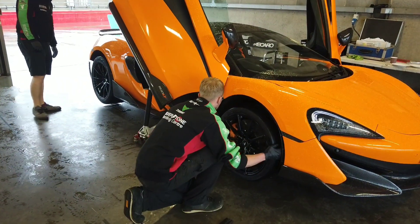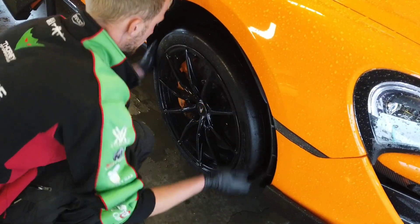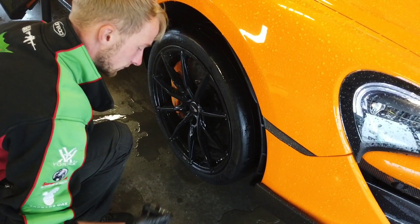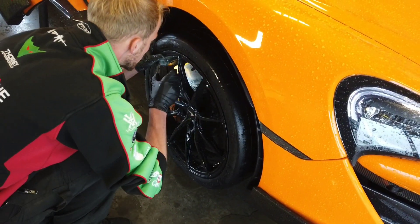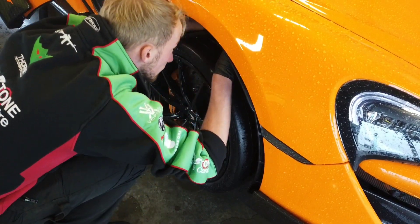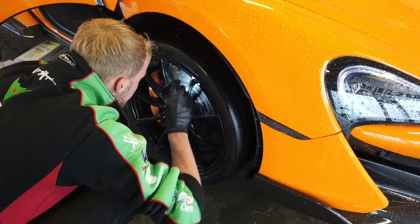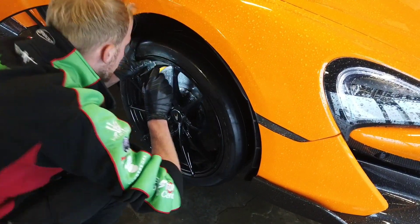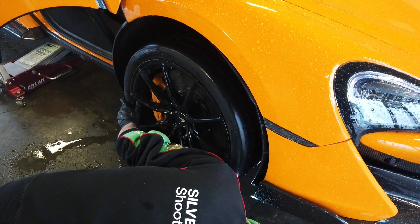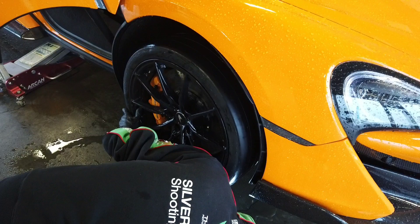What we're doing now is checking around both the front and rear wheels — mainly looking for play in the hub, making sure the wheel is all tight. Getting inside there, what we're looking for is evidence of suspension leaks. It's quite common that some of these cars have suspension leaks from the lifting system. Just making sure there's no leaks, no issues, no braid line issues. Also checking the wheel arch liners aren't dragging, and any under-tray bolts that are loose around there as well.